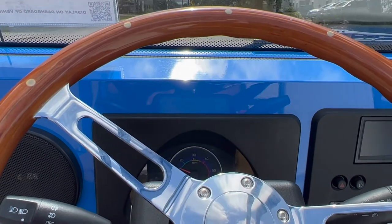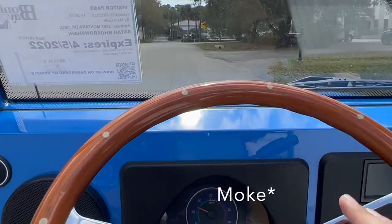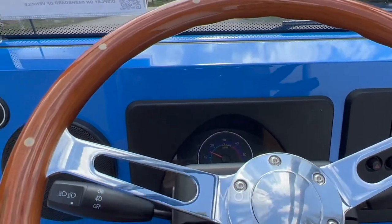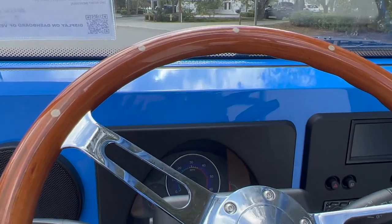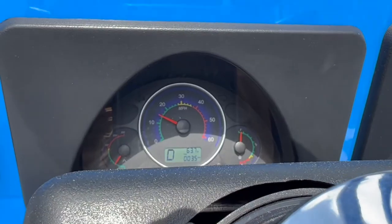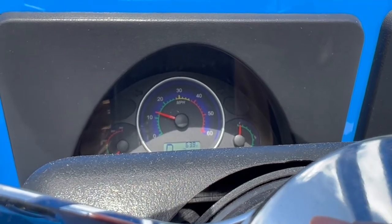Let's recharge the batteries — we're about to put about 20 miles onto the cart to see how good batteries are going to run. This customer's batteries died and we're going to see if his batteries are still good. We're currently almost at the four-mile marker and you can see the voltage is just hanging out around 63.